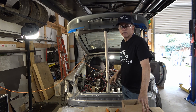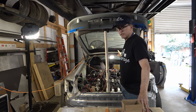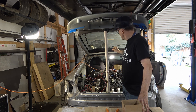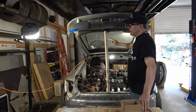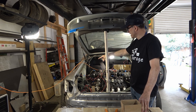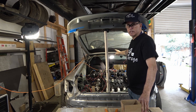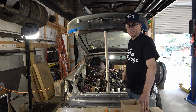All right, I have the wires hooked up according to what the internet says. I've got ground to the ECU ground — PCM ground — on the PWM. I've got the 5-volt reference voltage hooked to it, and I have the orange wire running to terminal L on my alternator. Let's fire this thing up and see what happens.